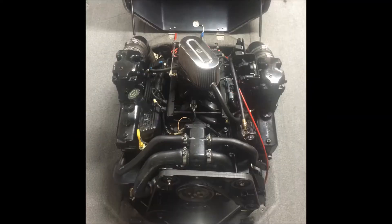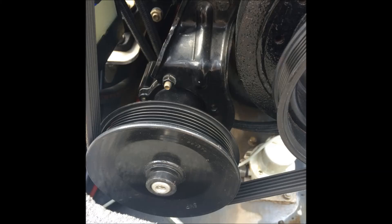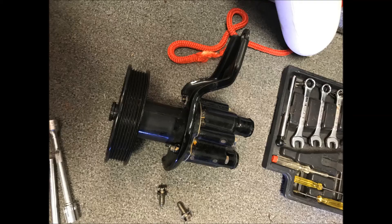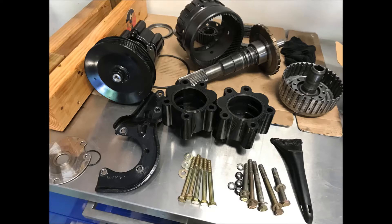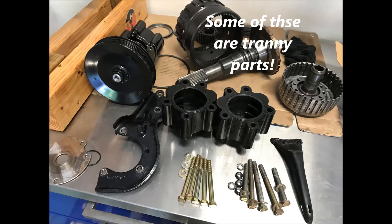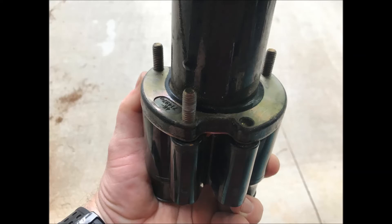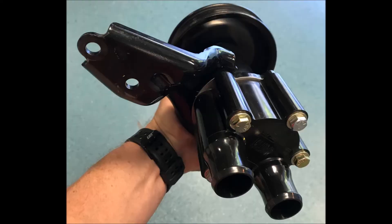Removal of my pump is rather easy. This is in a Sager boat, 1999, with a Mer Cruiser inboard engine. The water pump is located in the bottom left of the engine. All you have to do is loosen the belt as indicated — a couple of bolts hold it in, and there are two hoses in the back with hose clamps that need to be removed. At that point you can check the pump part number to make sure you're buying the proper pump housing and pump elements. I disassembled it — you'll see here on the bench all the parts required for reassembly. Now the new impeller is installed and I'm starting to put the entire housing back together. I also make sure that I clean all the bolts, remove all corrosion and rust, and repaint, to make sure corrosion is controlled. You'll see here the final assembly that's ready for reinstallation on the boat.